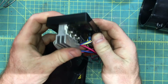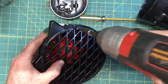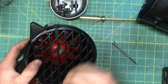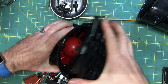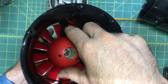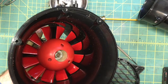This motor driver board is what has me believing how powerful this is. Six MOSFETs and this aluminum heatsink is huge. Got to get this grate off — it keeps foreign objects and foreign dogs from getting sucked into the intake. These magnets feel way stronger than the ones in other brushless tools I've torn into. This motor's mean. No wonder it can drain a fully charged battery — and, well, you'll see.